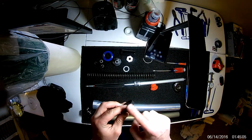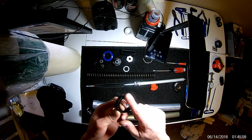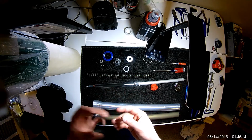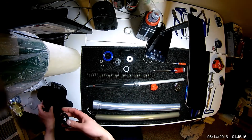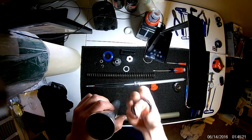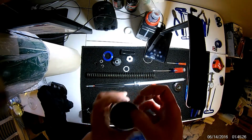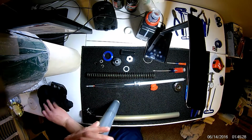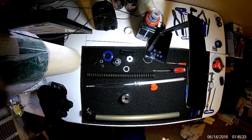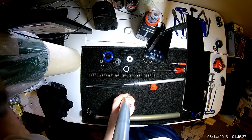and apply it around this seal. This just helps the seal go in. If it gets hung up a little bit, it's not going to tear the rubber. And overall, it just makes it easier to put into the fork. So remember, the spring side goes in, the flat plane goes out. You're simply going to get it started, just like that. Take your socket, and for this demonstration, I'll just put it down like that. Put the fork tube on top, and give it a good push.